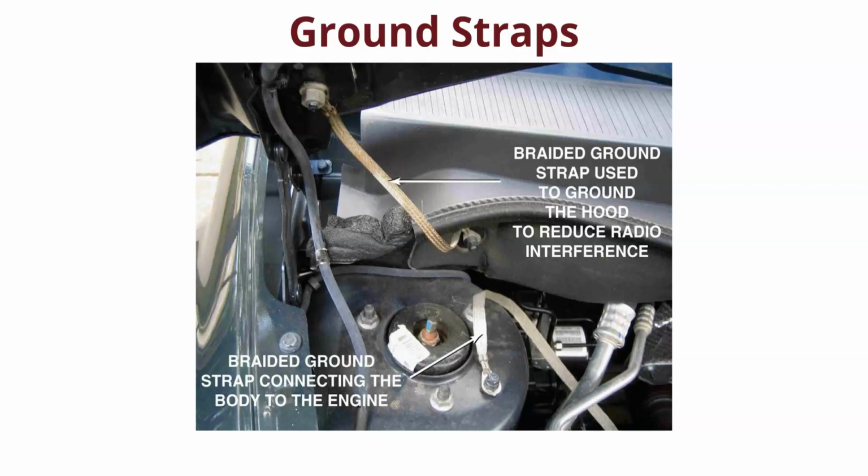because the crossing of the wires kills the AC voltage. So if you find these ground straps on a car, they need to be there. If you see one broken, fix it. That's the purpose of them. And notice that they are not insulated. They are bare. That's the way ground straps are. Once we weave the wires over each other, the AC voltage gets kiboshed.